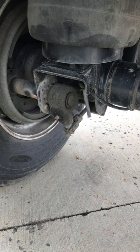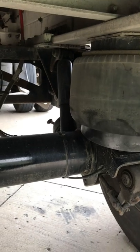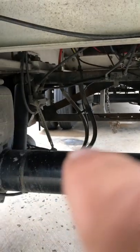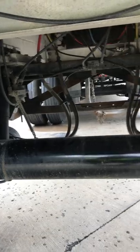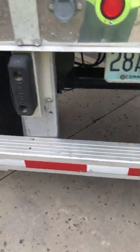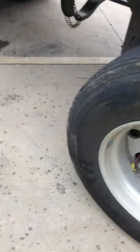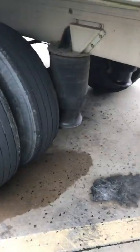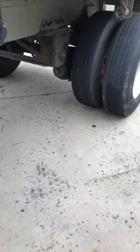When you pull it with your hand it shouldn't pull more than one inch. You got your shock absorber right over here, properly mounted and secure at both ends, not cracked or broken, not leaking. Airlines over here, properly mounted and secure at both ends, no bulges or cuts, not leaking air. And that's it for that. Just to make sure before you complete this — make sure you went over everything: spring mounts, air bags, spring arm, air hoses, brake chamber, the slack adjuster and push rod. And once you did that, you completed the trailer inspection.